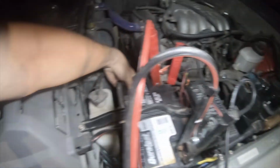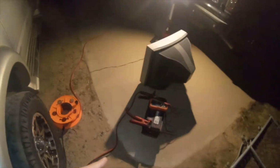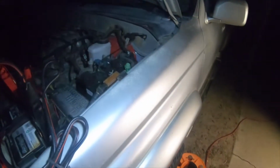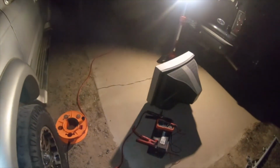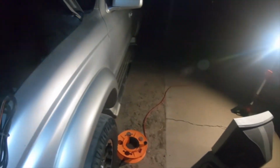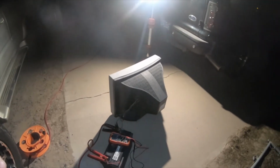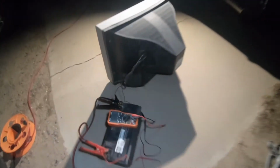And this battery isn't hot either. You also want to make sure that the batteries do not get hot, especially the one that is deeply discharged. You want to make sure that one doesn't get hot, because if it does, you could have a problem with the battery. And if it starts off gassing, because AGM batteries have oxygen and hydrogen in them, and if it off gases that, then they will never take a charge again. So just make sure that you watch this.